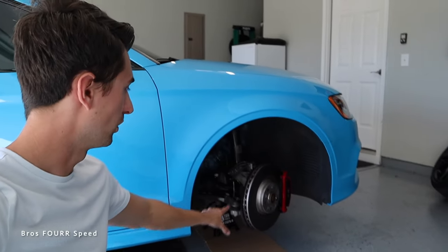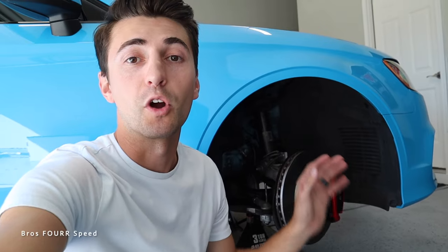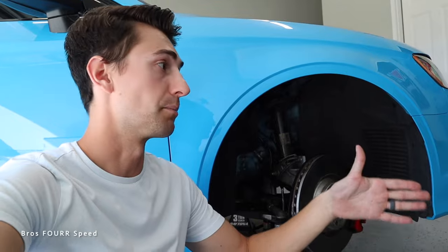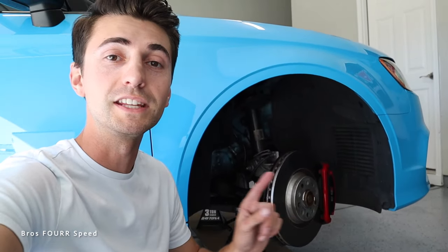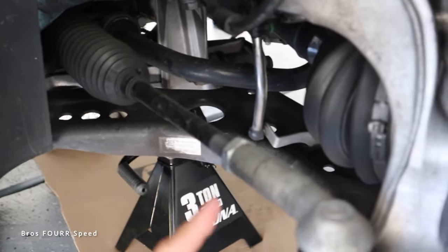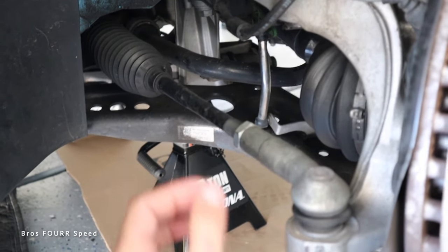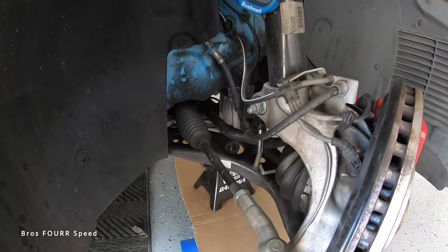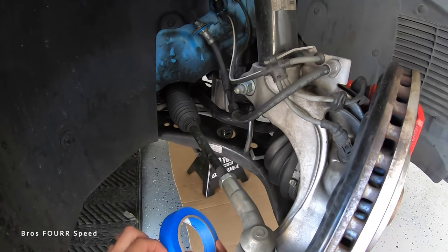You want to be really conscious about which direction to start pulling these rotors. If I'm holding the steering wheel perfectly straight and the car drifts to the right, that means the rotors need to aim toward the left. On the driver's side I already made that side smaller — pulled the knuckle in closer — so it started pointing to the left. On the passenger side I also need it pulled to the left, which means I need to make this side longer.